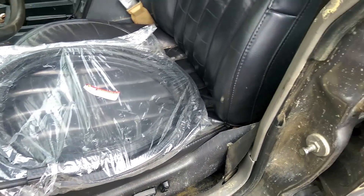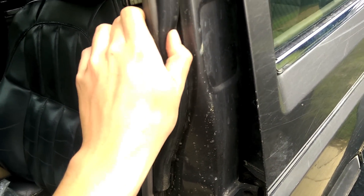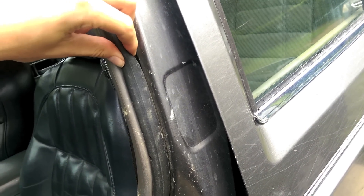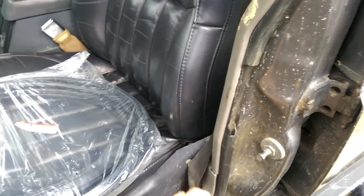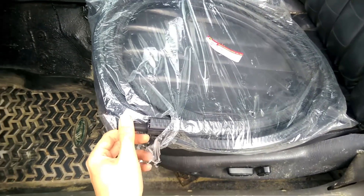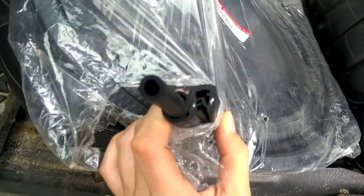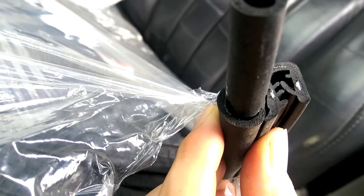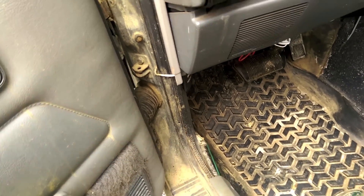I picked up a roll of brand new weather stripping. If you can go to a junkyard and find some that's still in decent condition it can be reused. There's also a cheaper fix where you can run nylon rope or something back behind it and it'll make it puff out more so it's a tighter fit. But mine's ripped so I might as well put some new stuff in. This stuff is a little pricey if you buy it new — $26 a roll and a roll does one door. It's got a squishy rubber part on one end and then a channel on the other where it fits inside on the ridge.